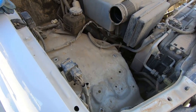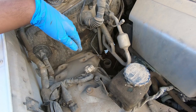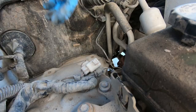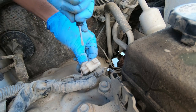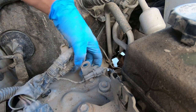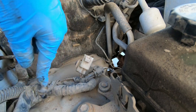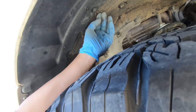Without the air box there's a lot of space here. The battery tray should fit right here with the compressor. According to the instructions it says to flatten out this little ABS clip right here — so instead of standing straight up like it is right now, it needs to go flat. The next thing we need to do is unclip this harness from the top right here. This is the actual ABS connector and it needs to fold flat, parallel to the ground. There's also a clip holding a bundle of wires underneath, so you'll need to go into the wheel well and push it out.